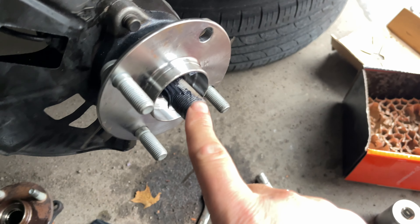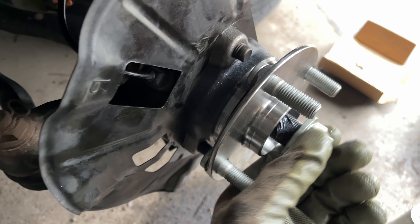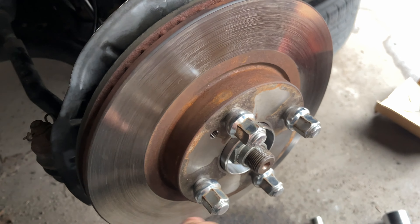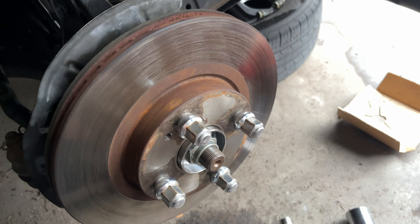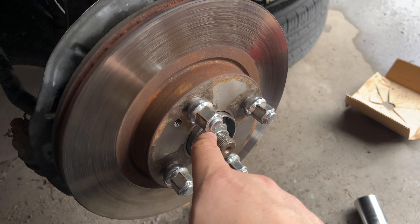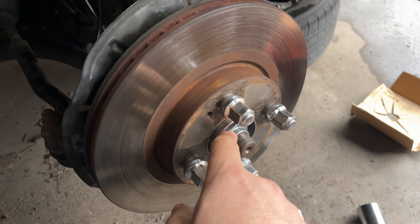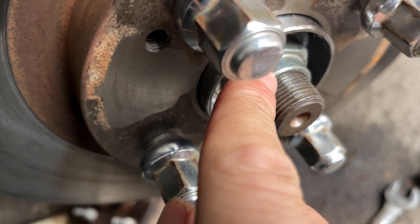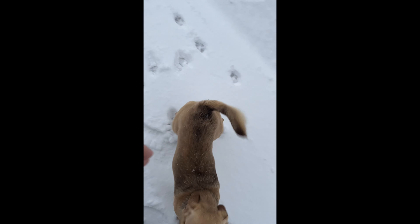This guy here — don't get it too tight, just get it on there nice. Now put your brakes back on. Make sure there's no grease on the rotor or you're going to have problems with shaking. Make sure this moves freely. This has got to be lined up close to where you marked it — see that little blue line? Remember I marked it? There you go.